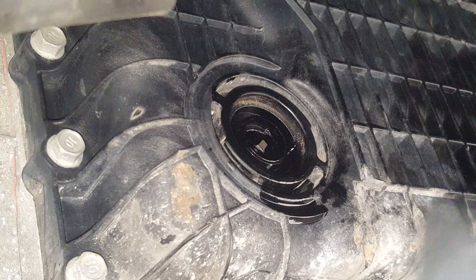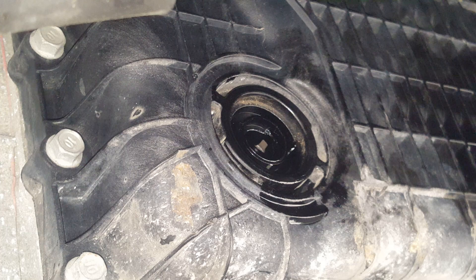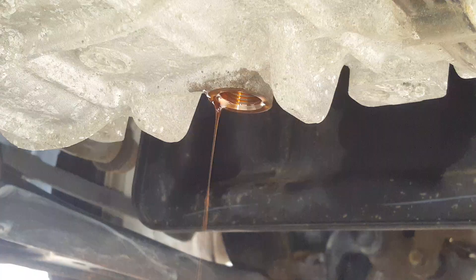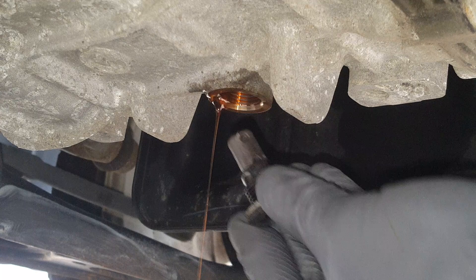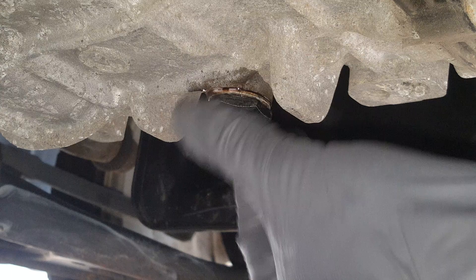You see people taking the vent loose from the top — you can do it that way, but that vent likes to make a mess and you've got to go really slowly. This way, as long as you keep the tube in here, you can pump it in pretty efficiently. This car only has 40,000 miles on it, so the fluid actually looks pretty good. But if you start off keeping up maintenance, you don't run into a lot of problems. It's when things get neglected with these transmissions — they've got to be maintained and these fluids have got to be changed.